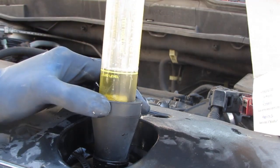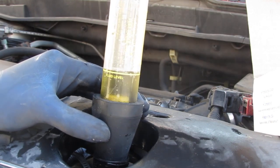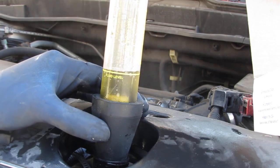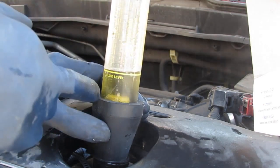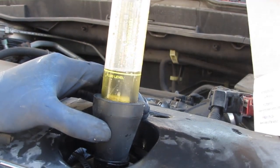You can see that is very yellow — that is exactly what we didn't want to see, but we knew that was going to happen anyway. So we have a blown head gasket according to this block tester. Let's turn off the engine and test it another way.